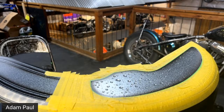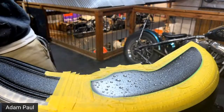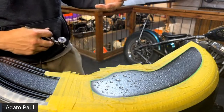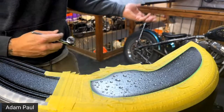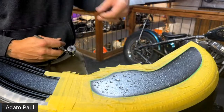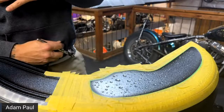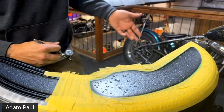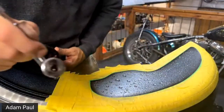And then someone said, you said you use 10 coats of clear to bury the glass flake. Did you sand between coats? Yes, so that was sanded in between. I laid down the glass with clear coat, added, I think, 3 coats. We did about 3 coats on this one. After that, sanded that down, and then did the graphics on it to this point. And then it was clear coated with another 4 coats, sanded down. If you were to add the coats of what was actually carrying the glass, I'd say about 10 coats.